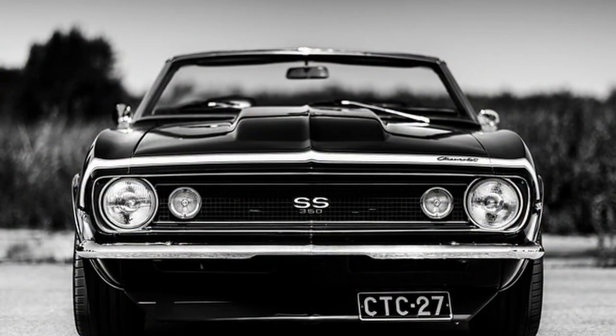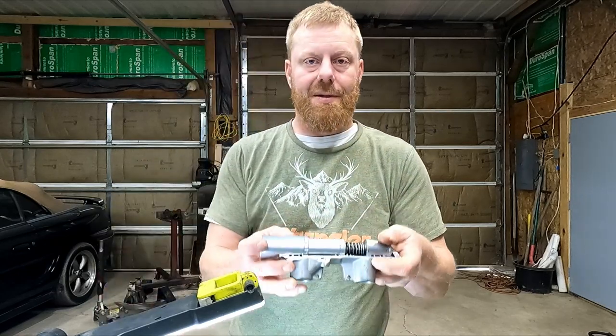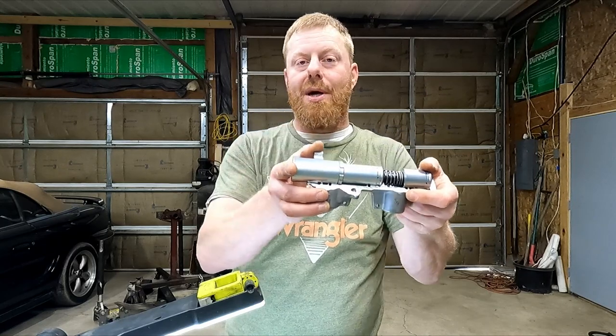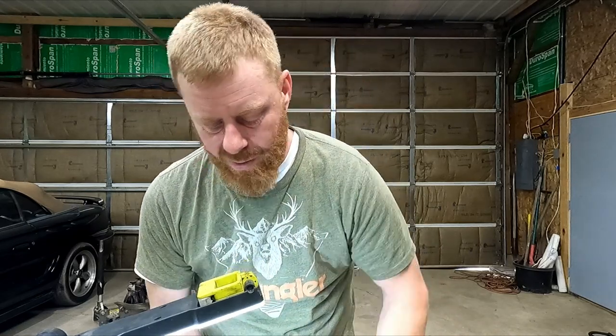If you've ever driven an old truck or an old car, like from the 1960s or earlier, that had manual brakes, that means that all the force from your leg pushing the fluid, that's all you get to the brakes, no extra. So that's a pretty simple explanation of a master cylinder with a cutaway view so you can see how it operates.